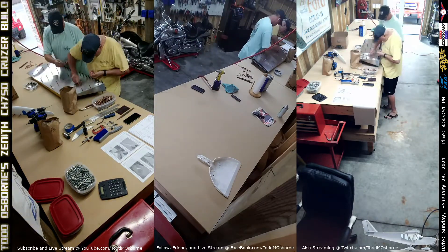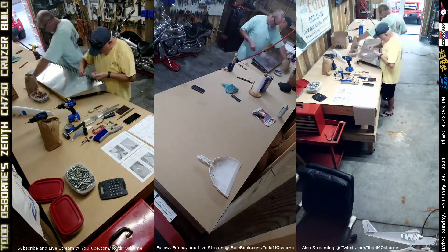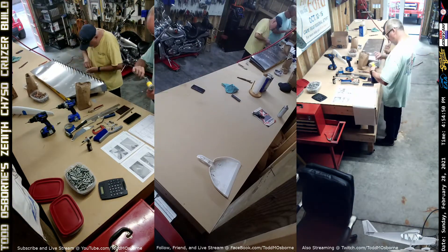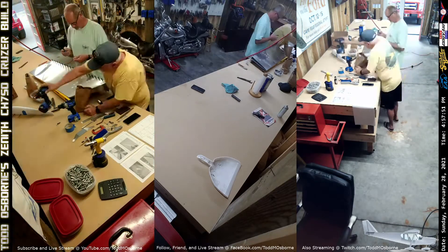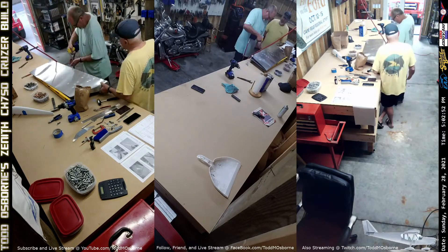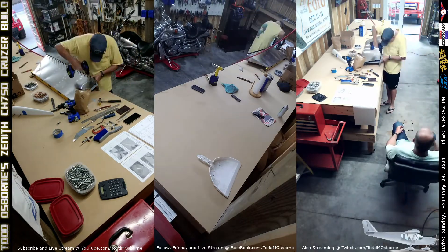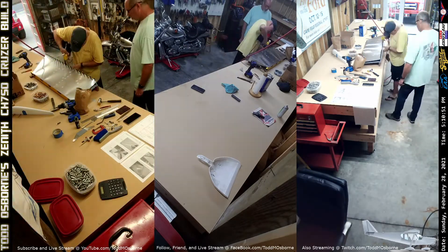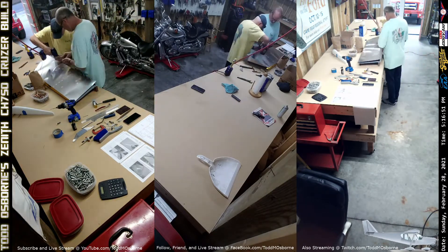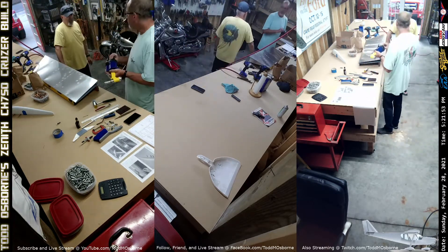The goal, like I said, was to get the rudder completely done — that didn't happen. The lower horn still needs to be attached and the plastic tip rib still needs to be installed. Only the 10 forward rivet holes are drilled in it right now, so it has to be fitted and everything else drilled. But very good progress today. Six hours standing on that concrete — my feet were just killing me. So at this point in the day I was seriously thinking about calling it quits, and surely did. But good day, a lot of good progress, and the rudder will be done very soon.